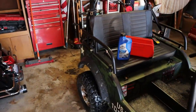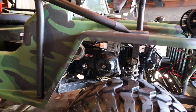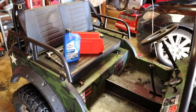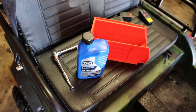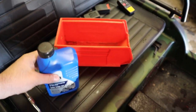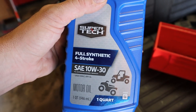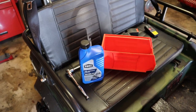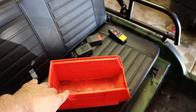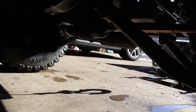Back here at the house. I already went ahead and lifted up the Jeep with my motorcycle jack — it will help get all the oil out quicker, and I want all of it gone because it is the first oil change. Here's what we're going to need: a 17mm socket and ratchet with a short extension, full synthetic 4-stroke oil by Super Tech, 10w30. A lot of guys use 15w40 but that is more for hotter climates. And of course I have my oil pan to drain it out.